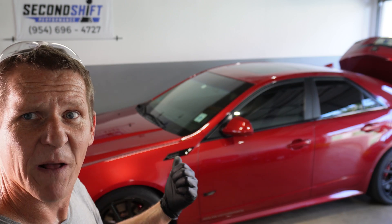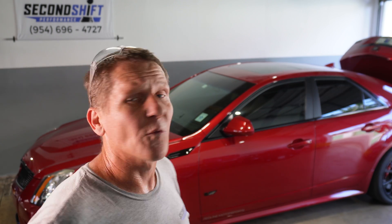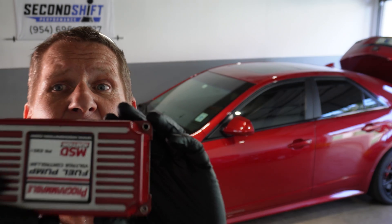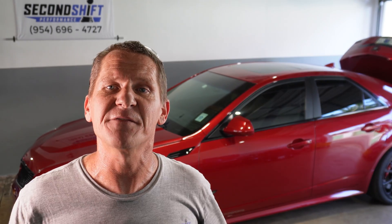For this install, the 2010 Cadillac CTS-V does not take straight power directly to the fuel pump. It has a fuel pump control module that varies power to the fuel pump. Because of that, we can't directly connect the MSD 2351 to the fuel pump voltage — and the way it was previously connected created a parasitic draw. If you have a late model vehicle with a fuel pump control module and you're trying to get an MSD 2351 controller to work, this video is for you.